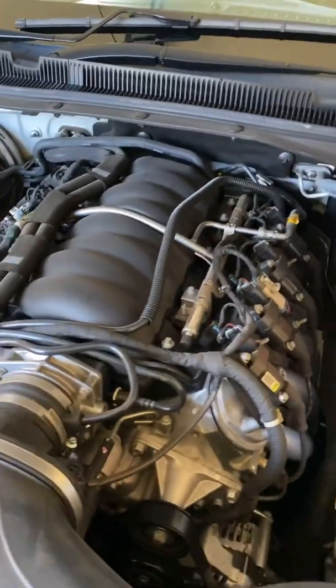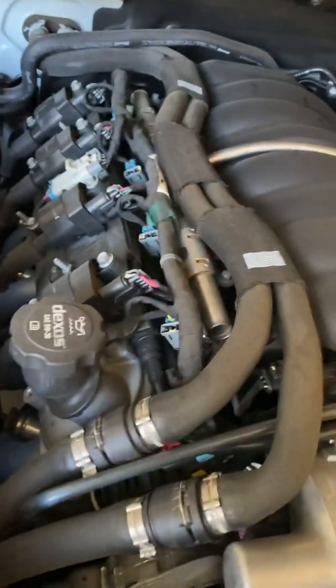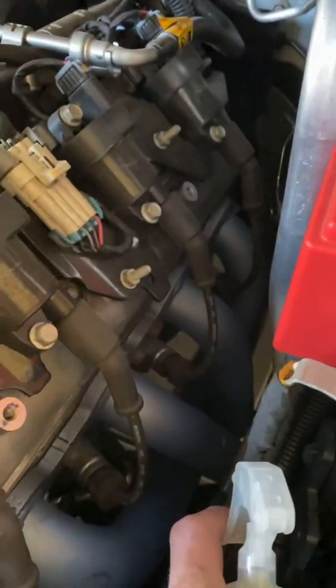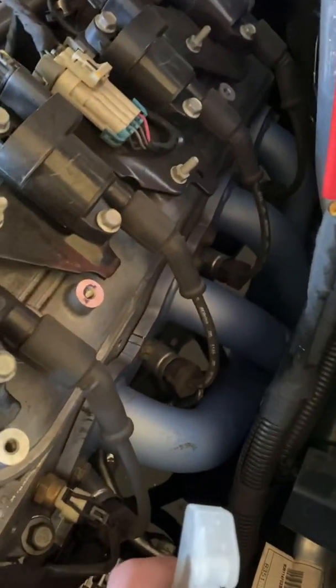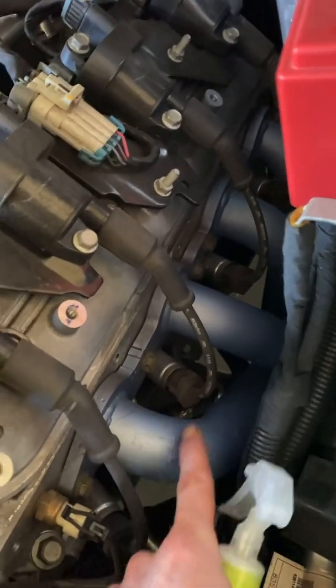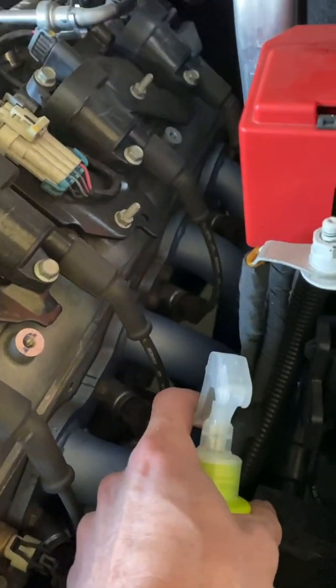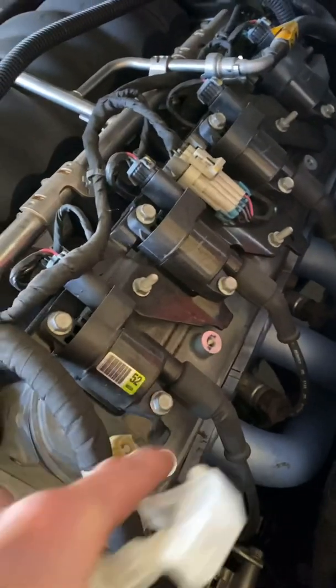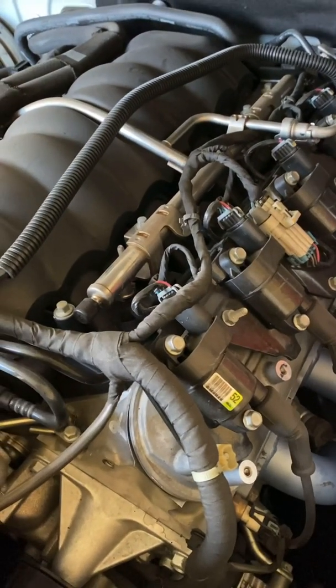What I'm going to do is basically just to see which cylinder it is, let's start spraying some cold spray on there. That one's steaming, but it's definitely not that. There's some steam coming off that, so it's not that one. Oh, there you go — see that? It's just stone cold. It's a little bit warm, but it's not hot like the other ones. That's steaming off, you can see. So that's straight away something to do with this one here.